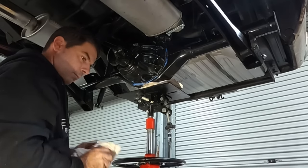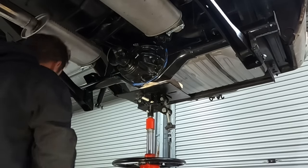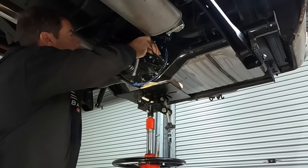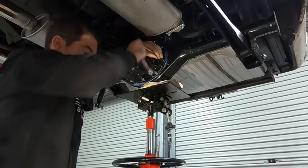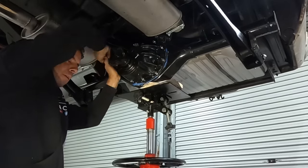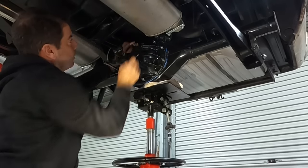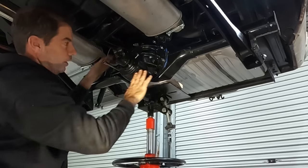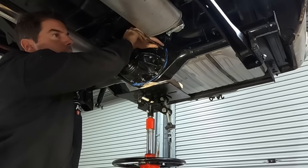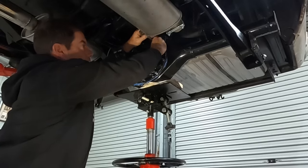Get these bolts that took me nearly 2 hours to go and get, and we'll nip them in. I'll just bring them down so they're snug on the face. Probably doing like that really. And I only go from side to side, top to bottom. If you just start there and start nipping it in, and there's a gap over this side, by the time you get to about there and here, it's bound up on the threads because it's tilted that way, so it doesn't go in. You think you got it tight and you look over there, or you don't look over there, even worse, and you've got a gap, so it's never going to seal.